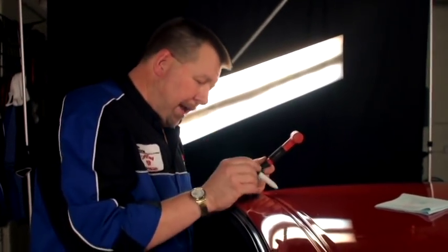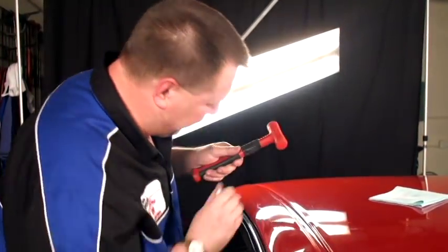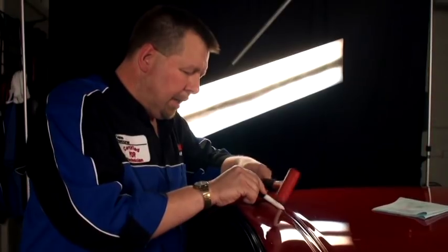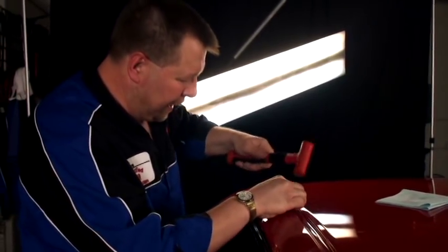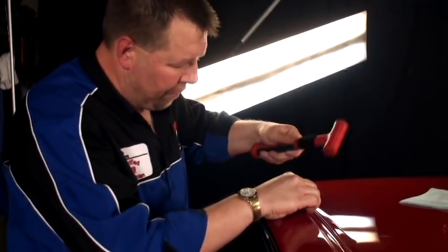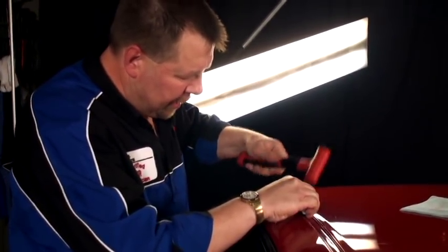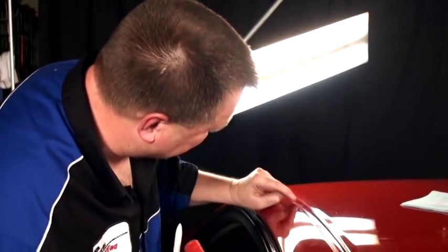What I'm doing with this tap-down, I'm in essence using it like a dolly. This dent is knocked all the way through the edge and there's even some paint damage there. But I'm knocking that body line back into place by directing the hammer blow this direction and taking any kink out of that to help loosen that edge, so when I glue pull it's apt to lift.